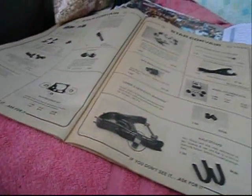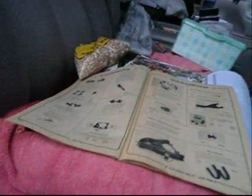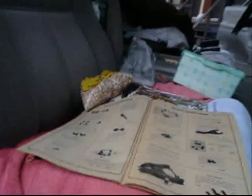And people mentioned that in shop class or aviation class for rebuilding, if they would click the torque wrench twice, their director or inspector would make them discard it and install a new fastener. I just clicked the torque wrench a couple times just to show you, just to make sure you heard the click. But I didn't crank on it and move the nut.